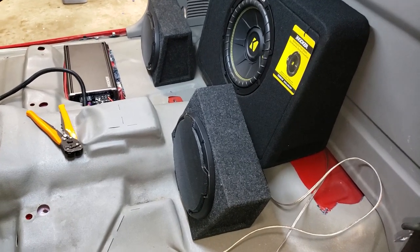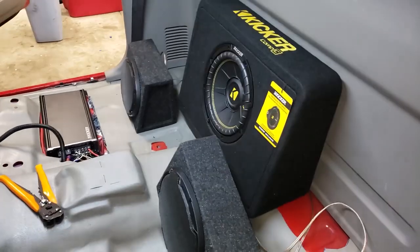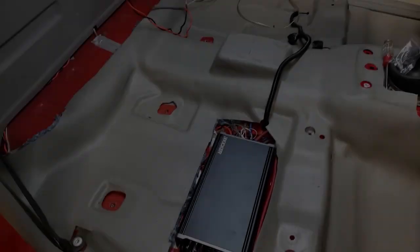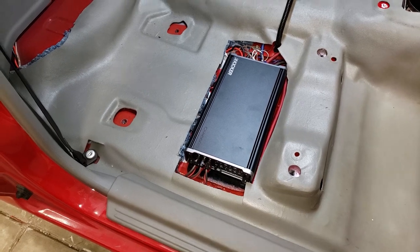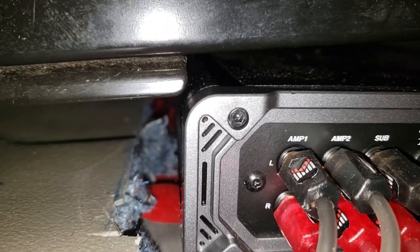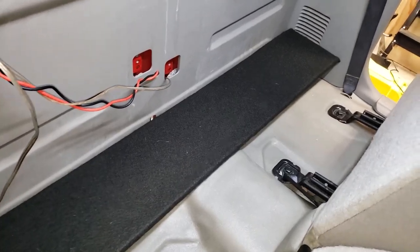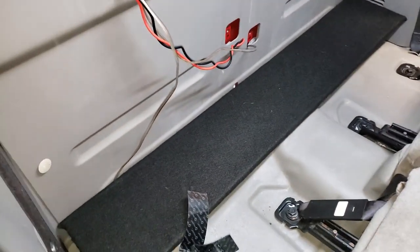It's reality check time. I've got everything for the very first time ever all plugged in, and I want to run a test to make sure everything's working before I put the seat back in. Everything works — everything's good. I've been stalling for at least a half hour listening to music, but it's time to get the seat back in, which has been scaring me because of how close it's going to come to the amp. I've got a millimeter maybe, but it's in. I've hit the seat bolts with some blue Loctite since I've had them in and out so many times. The shelf with magnets is locked down and not going anywhere at all.